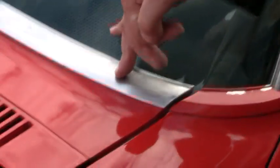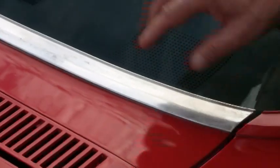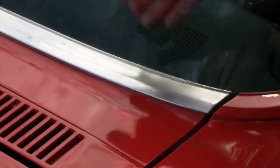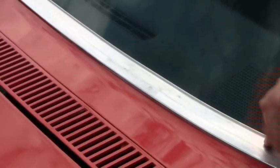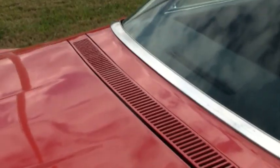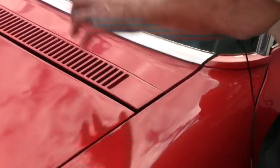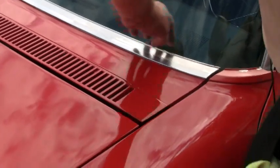Now these are stainless steel and this is supposed to be painted red, just like the other small trim is painted red. You can see some flanking. Some people when they painted the cars thought it would look nice to have this extra metal exposure, but that is not correct. If you want to make it correct, paint this to match the car. This is your pop-up disappearing wiper cover that was on the '68 through '72. It works off of vacuum — when you turn on the windshield wipers, the tray by vacuum comes up and then the wipers pop out.